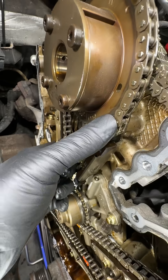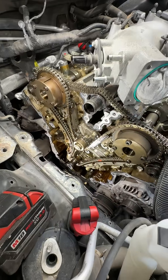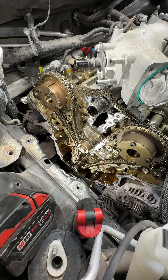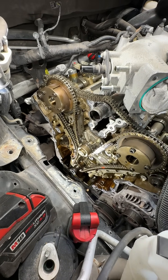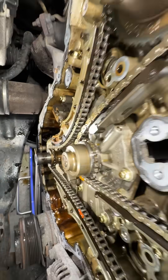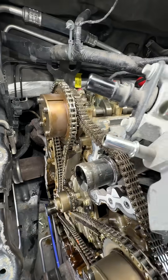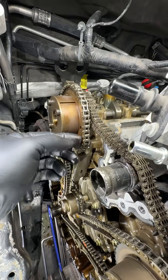If you add it all up, it's almost ready to skip a tooth. It only took Ford two to three years to realize they can't run a bicycle chain as a timing chain, especially when it's one continuous chain all the way around. All those links add up, the wear starts happening, and then it'll start stretching out like that.